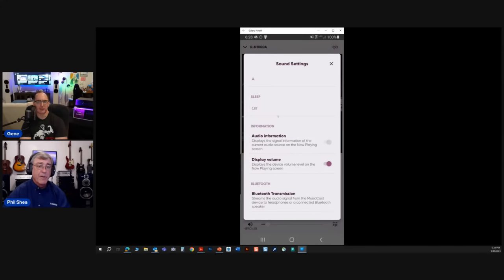And that's the other thing, Phil, about YPAO: it's one of the few correction systems that goes all the way to full sampling rate. I think it does it in 96 kilohertz, right? It doesn't downsample. No, it doesn't. It's a 64-bit 192 processor that does the calculations, and it can handle up to 192 under certain conditions.